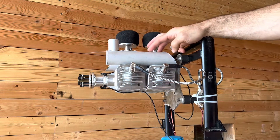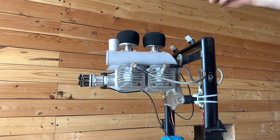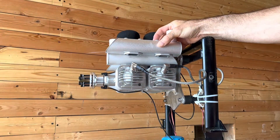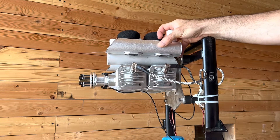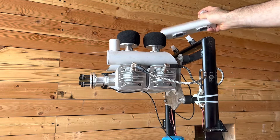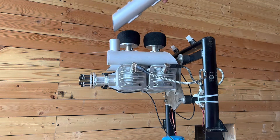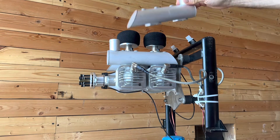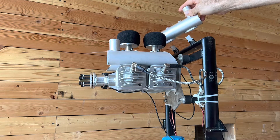We're going to take this four-hole muffler off because now I've got the three-hole muffler. It's not really meant for this side, but I'm going to switch it out so that my exhaust ports are next to each other. I would rather have them both going this way further out, but I can't do that because I can't fit a four-hole muffler on this side.